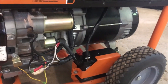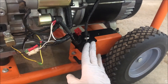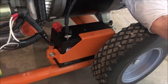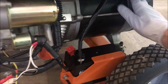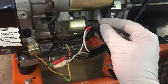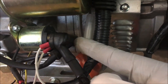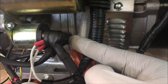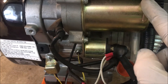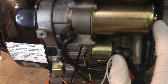This generator also has an electric start system. To accomplish that there's a battery with two big wires coming off it. The black wire goes right up to the stator housing and is bolted on, so the whole chassis has a negative ground. The positive wire comes up into a relay. There are two posts on it: one is hot from the battery, and the other — when you tell the engine to start — receives power and sends it right up to the starter motor. The motor is negatively grounded through the body of the machine.